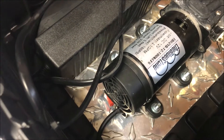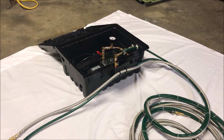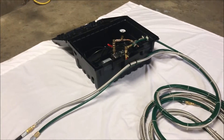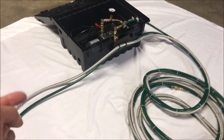Sometimes when you turn the pump on it won't do anything — you'll have to turn it back off and turn it back on. It has something to do with this type of transformer: sometimes if you put the switch on when the AC current you're hooking it up to is at a certain phase angle, the transformer won't kick on. So just turn it off and turn it right back on and the pump will turn back on.